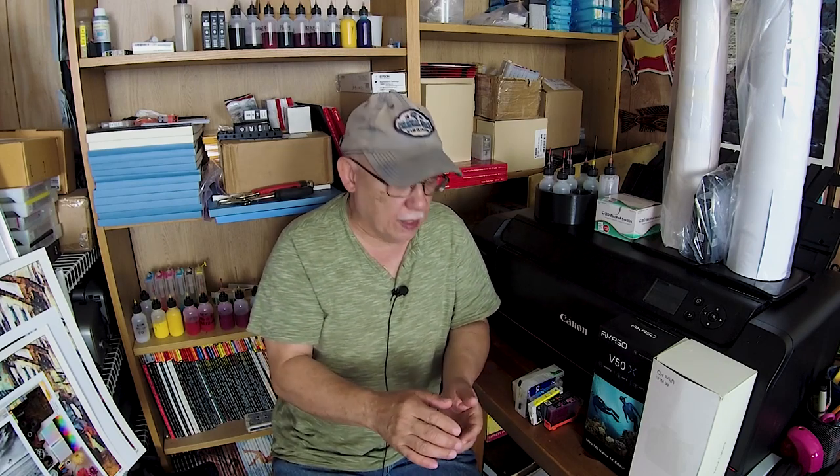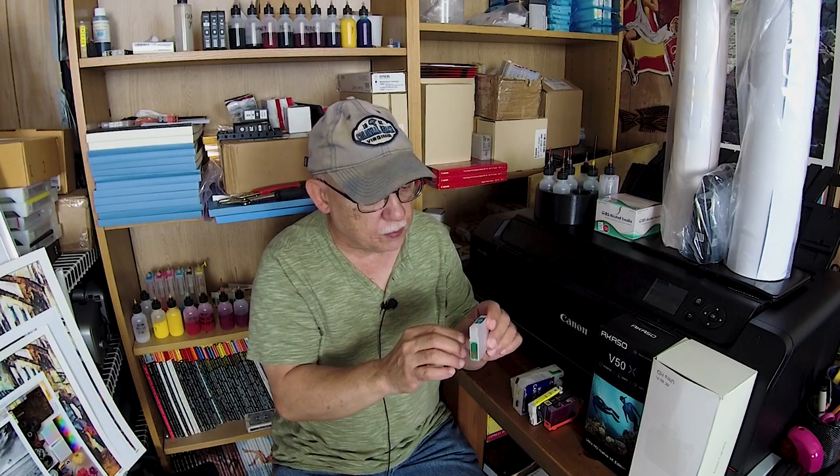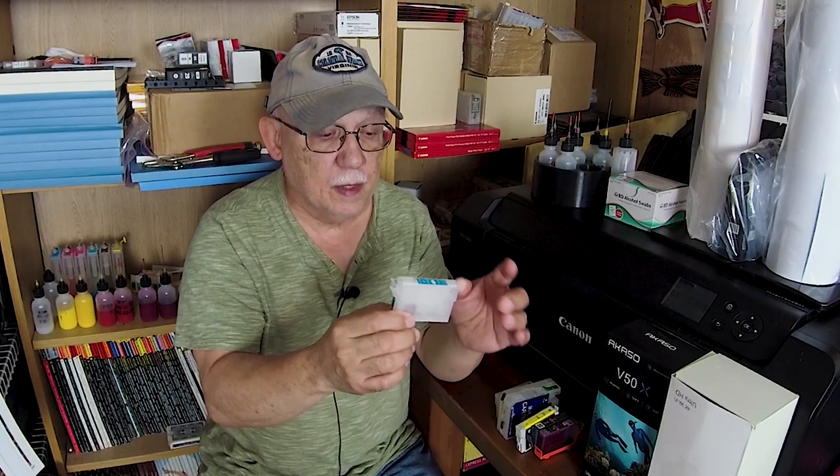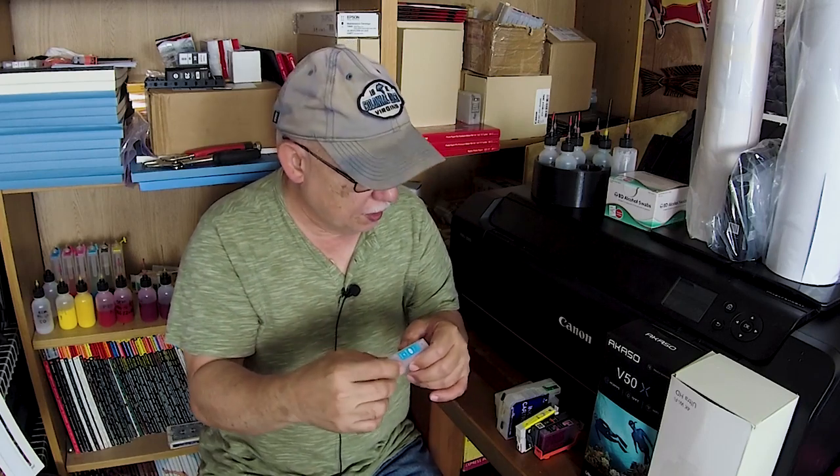I thought back to the days when I was refilling that printer — which I no longer have — and yeah, I remember some instances where my cartridges would literally leak out. What would cause that? It could be a seal that's not sealing properly. This is a typical Epson refillable cartridge — you have the fill plug, you have the vent plug. If this vent plug or its o-ring is not sealing well, you will have leaks. Precision Colors owner Mike Lee stated he has seen that before, usually due to very loose manufacturing practices.